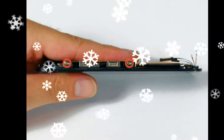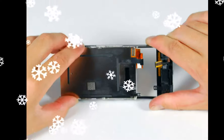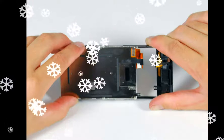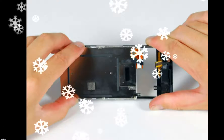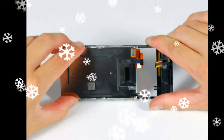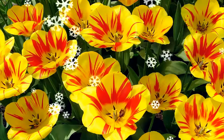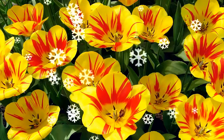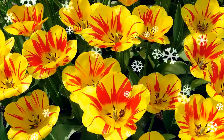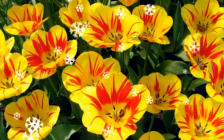You will know the logic board is correctly installed when the SIM tray is aligned with the opening in the iPhone case and the camera module sits neatly in its place. Use a spudger to pry the battery up from the rear case. The battery is attached with an adhesive strip around its perimeter to prevent bending during removal — we recommend against using just the plastic pull tab. Note: removing the battery is not necessary for replacing the GPS antenna; it merely gives you more space for removing the headphone assembly, which is also unnecessary to completely remove.